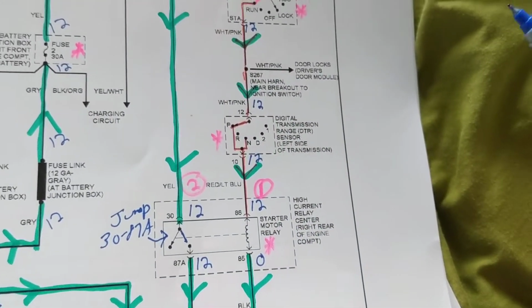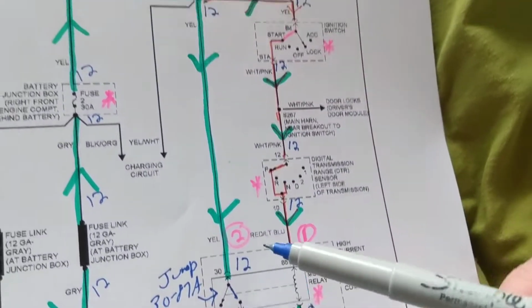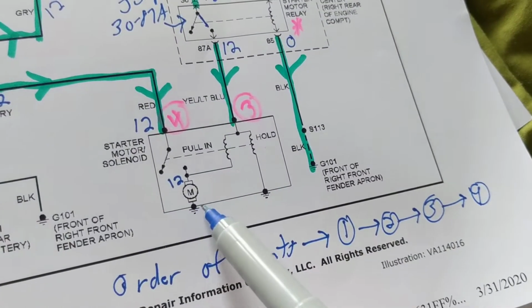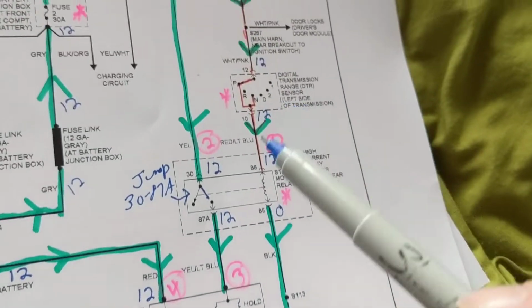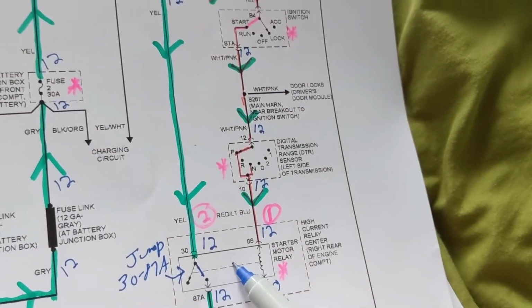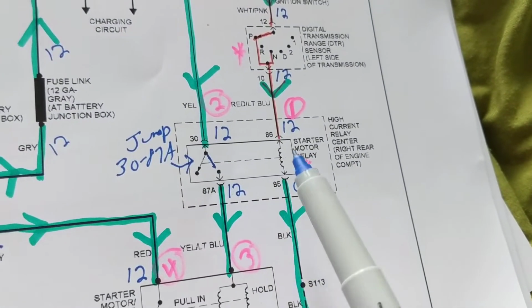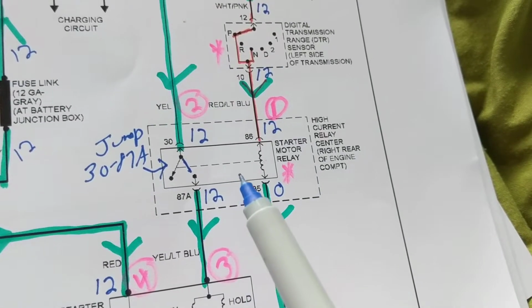And I hear nothing. I hear absolutely nothing, right? Well, how to approach it, how to attack it. Well, we know the starter might be somewhere under the chassis or somewhere hard to get to. So where do I concentrate on? I'm going to concentrate on the relay or the fuses. Why? Because these components I could get to easily, right?